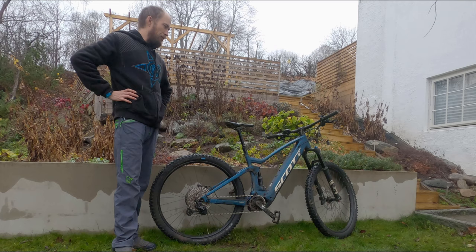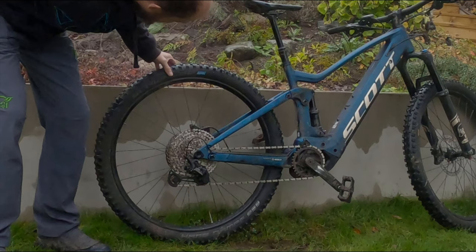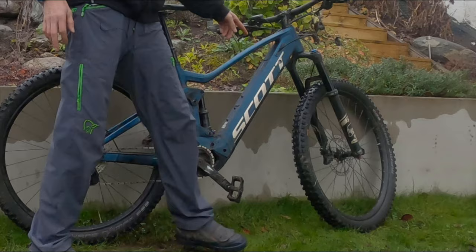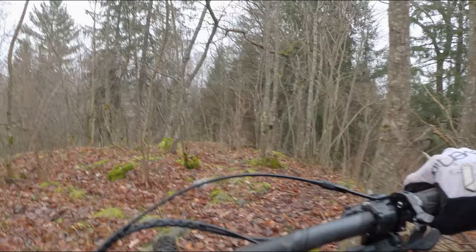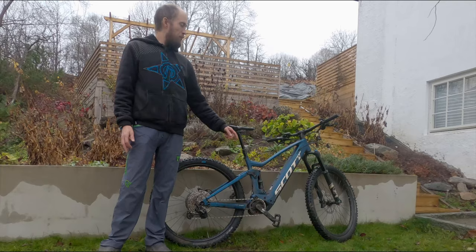I'd prefer the Shimano MT520s with the shorter one-finger braking lever, and that's pretty much all we have to complain about. The rest of the bike looks very good. I like the Fox 36 Rhythm fork — it's a really nice one. The Fox Float DPS shock is decent, no complaints there. Tires are the Hans Dampf by Schwalbe Speed Grip at the back, 29 by 2.6 inches, and the grippier Magic Mary soft compound at the front. The rubber compound on the Hans Dampf Speed Grip is a bit hard for these conditions, but as an all-rounder for all-season riding it's a great choice — it offers a bit of speed, and the grip on the front tire is really great.